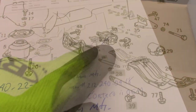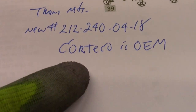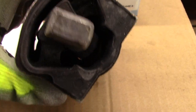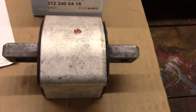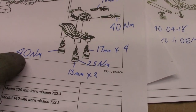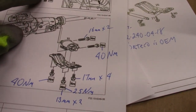I'm going to be replacing the transmission mount. Right there, that's the part number, and from what I can tell that's the OEM part — that's the manufacturer — and it looks good to me. We'll have to see how it compares to the old one when I get them side by side. I printed some stuff off the web, mainly the Newton meters and what they're set at.